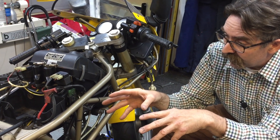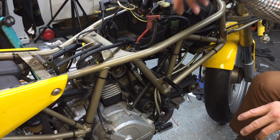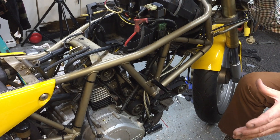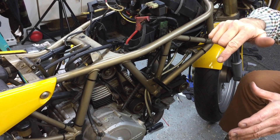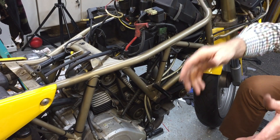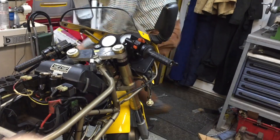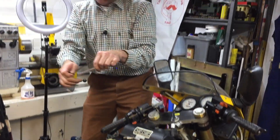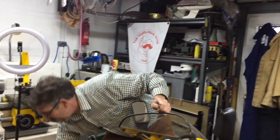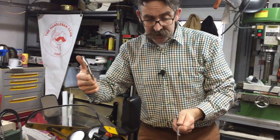I used the pistons to my advantage. Because I needed to drop the valves down — especially on the back cylinder because it's upright and you're fighting gravity — you just gently lower the piston down, feel the valve, and let the valve slide down just enough so the end of it goes past the top of the valve guide. Put your stem seal on, and then with the hooks I made, you can gently ease the valves back up into position. Then with a clamp, put a clamp on top of the valve to hold it in place whilst you carry on working on it.